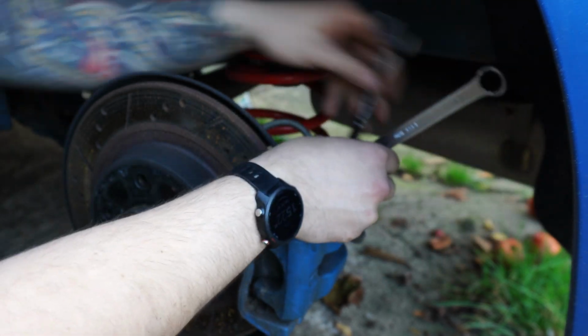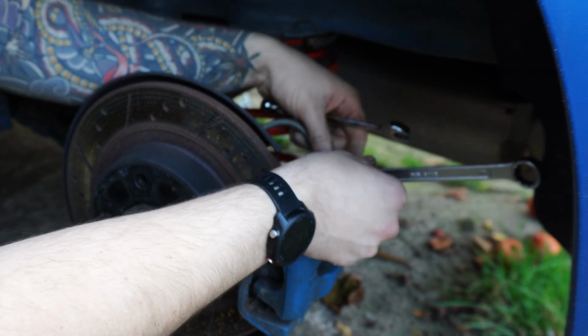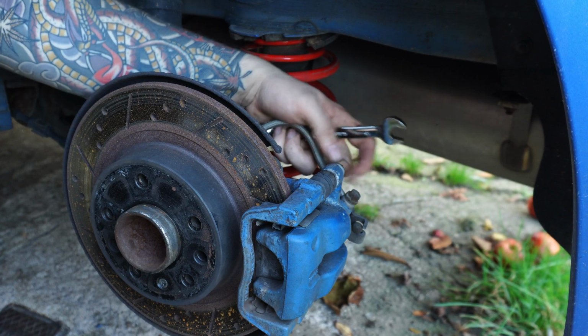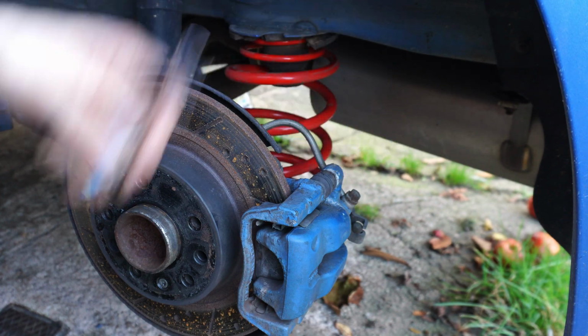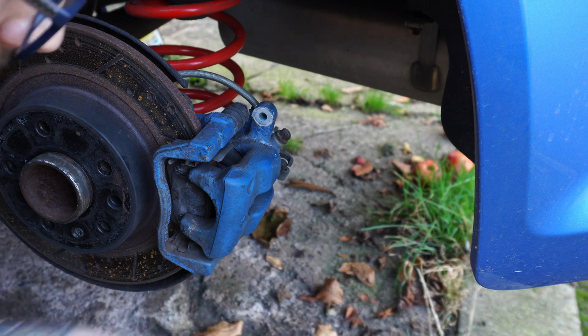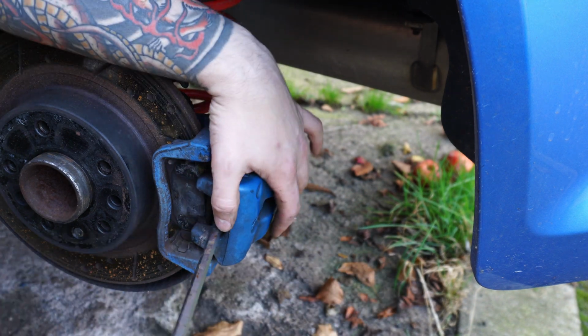Wait a minute, this isn't a big brake. Since my MOT was due and every pad on the car was worn to below 2mm, I figured I'd throw some new rear pads on as well, and some discs while I was at it. These come apart in a similar way to the front, except you need 2 spanners to get the sliders off, before you can remove the caliper to get to the pads and the bracket and of course the disc.